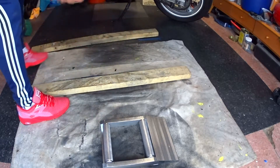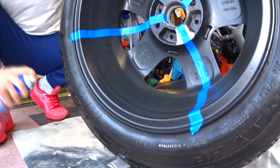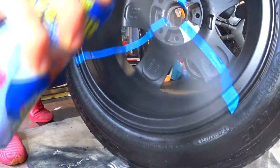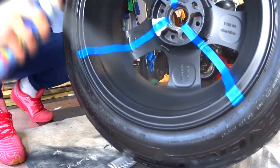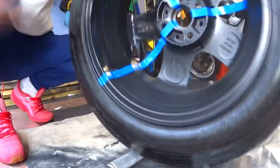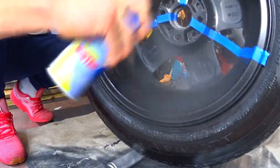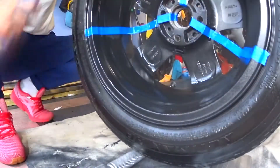Taking all that into account, we're going to spray the wheel barrels. I sectioned the wheel barrel off into three parts. The first section gets one pass representing not enough glossifier, the second section gets four passes representing an excess amount, and the third section gets two passes representing just the right amount to get the perfect finish.